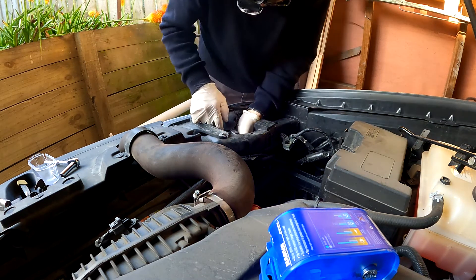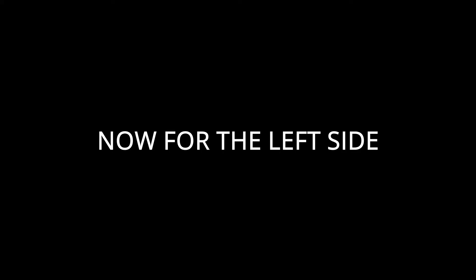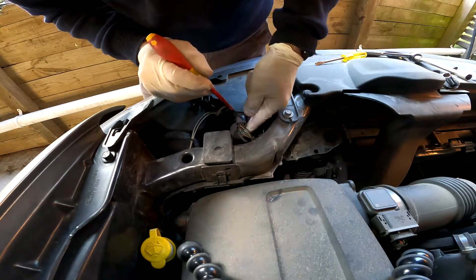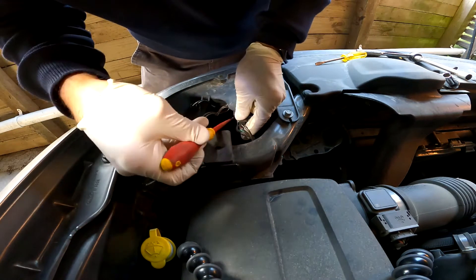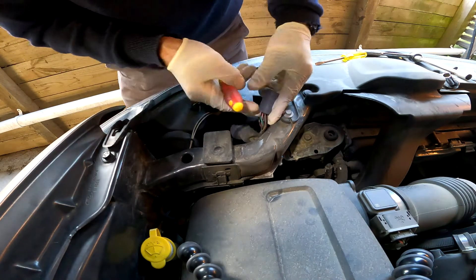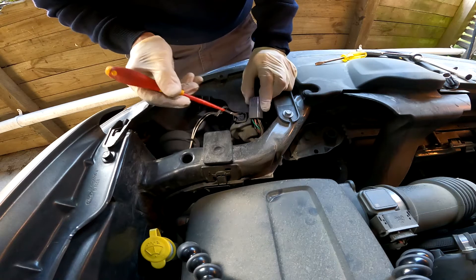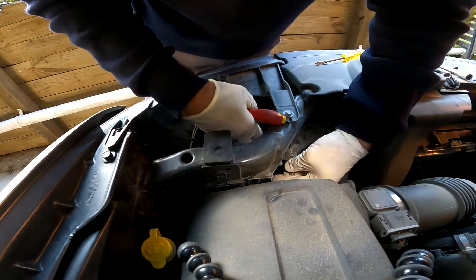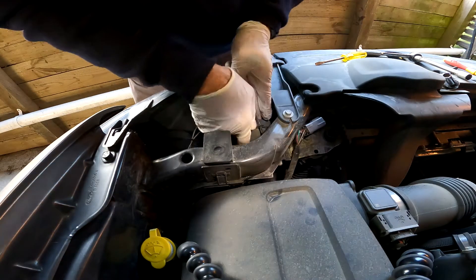The wire has got heat protection on it. Put the cover back over. To get the bulb out, the first thing you need to do is disconnect this connector here — it's got little clip things on the side of it, so you just spring those a bit. They basically just slide in and there's a little bit that catches on one side, so you just spring that and get it out of the way. I just used a little fine screwdriver to get in there.